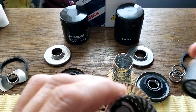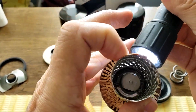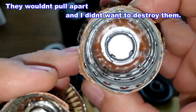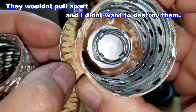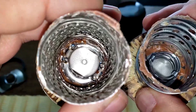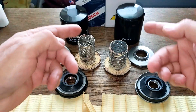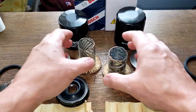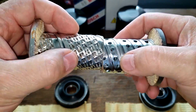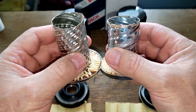Looking at the louvers, they're opened up and look fine. The glue inside: the GKI has a lot of glue but it's a strong brownish glue, not the soft black stuff seen on some other filters. Same with the Bosch — it has a brown glue that's firm, not soft. I give the can to the GKI because it's thicker. The Bosch filter has bigger pleats because its center core is narrower — you can see it fits right inside the GKI core — making for longer pleats and more filter media overall.